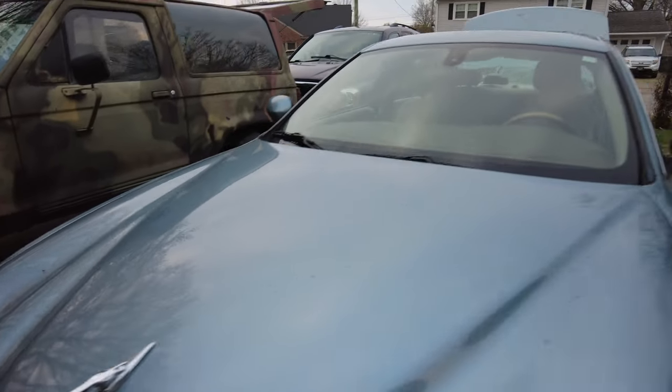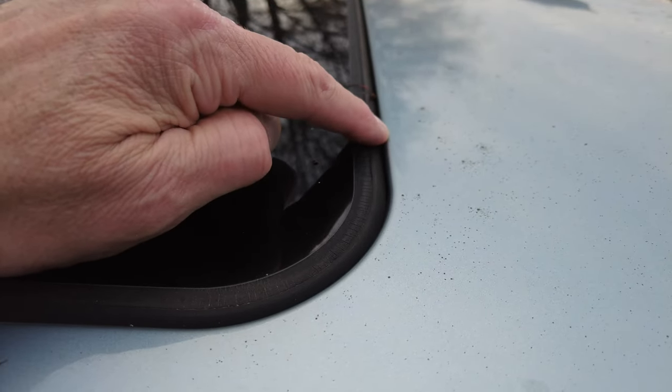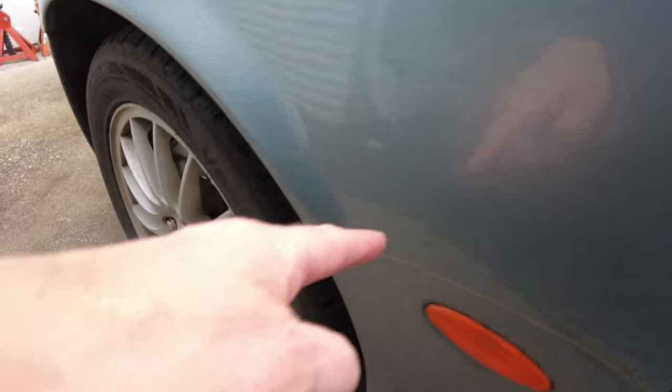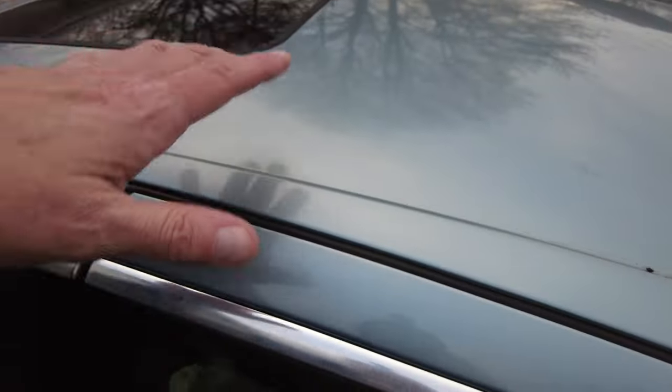The back floorboard of the Jag is soaking wet with steamed up windows. This is from sunroof water getting through — if this is not a sealed system. There's a hose that connects here and goes all the way down and comes out at the bottom. The problem is the hose runs horizontal at one point, which is why it plugs up. The front ones are open but the back ones are plugged.